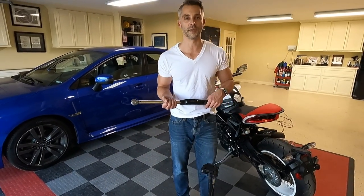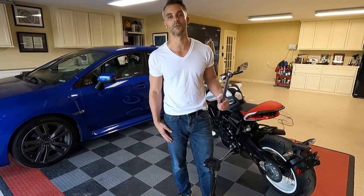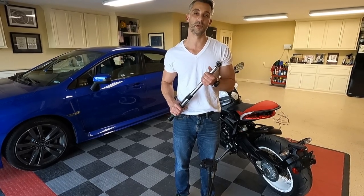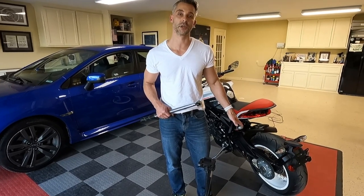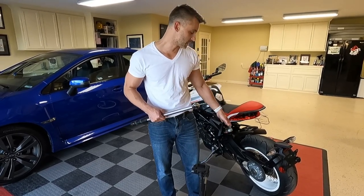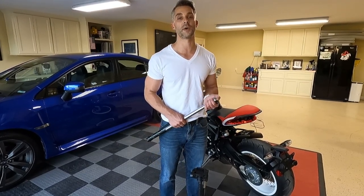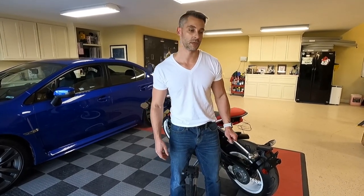Fortunately we've got the torque wrench with a digital readout that makes life so much easier. If not, you just get on your phone and do a unit conversion from either foot pounds or inch pounds. This is a half-inch drive — it's a bit of overkill for what we need. The stickers on the bike are really good at identification; there's a sticker right on the swingarm that tells you this is a 28 to 32 Newton meter torque spec on these rear bolts that pinch the axle once you get it to the proper chain tension.